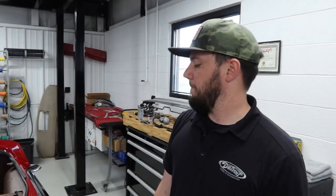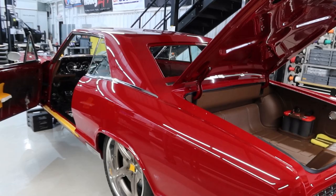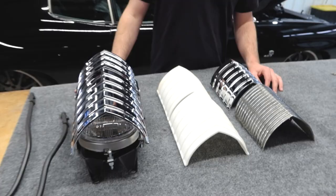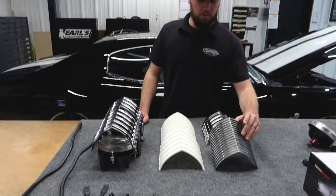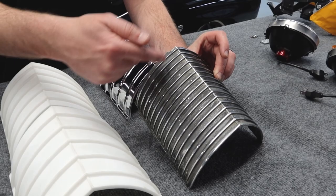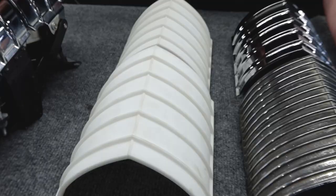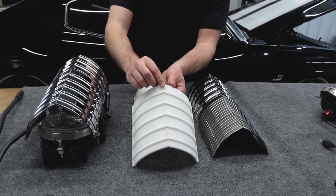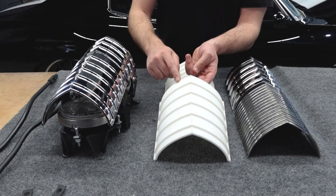We're hoping to send this thing out for upholstery probably early June or late May. Another cool thing to touch on is the headlight clamshells right here. You can see the iterations of the headlight clamshells. If you're familiar with Rivieras, this is the original headlight clamshell — it has a real tight spacing in the horizontal polish features. What we did is we wanted to match the grill bar spacing. We scanned the headlight assemblies and designed these components so that they match the grill spacing at bar height. These are 3D printed — so during fab we mocked up these 3D printed clamshells, cycled them, made sure they lined up with the grill, looked really nice and symmetrical all the way across the front.